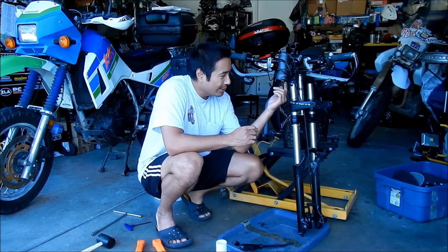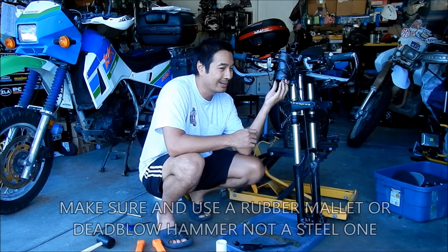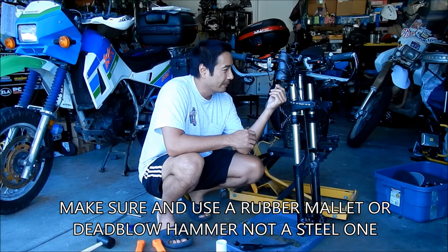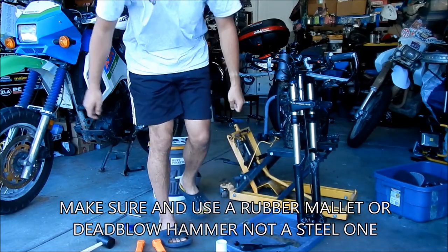But anyway, just make sure you're hitting the cup and not the race. Don't damage the race there. The race is the one that's important. But yeah, it's in there now. I'll get a closer video.